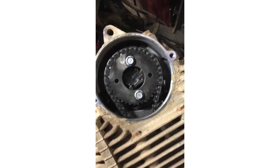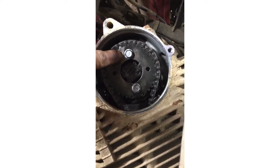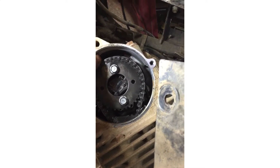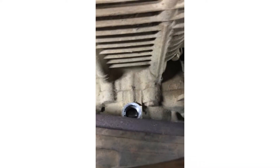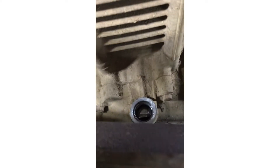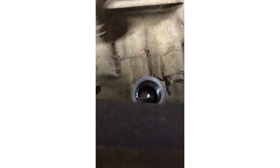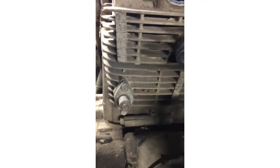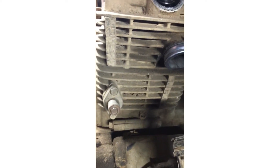With all your covers off, I've got a timing mark right here — a line that lines up with that notch on the outside of the cylinder head casing. That's the timing mark to line the cam up. Then off in that hole right there there's a line with a T on it — that means top dead center. Now that you've got your timing marks lined up, you can come back up here and remove your timing chain tensioner, held in by those two 10mm bolts. That takes your tension off your timing chain.